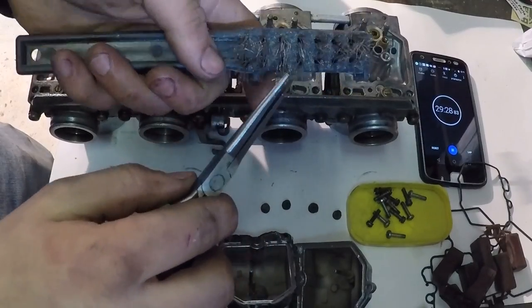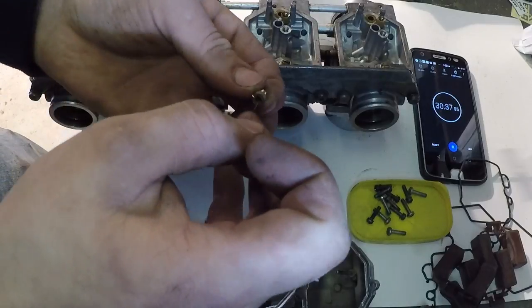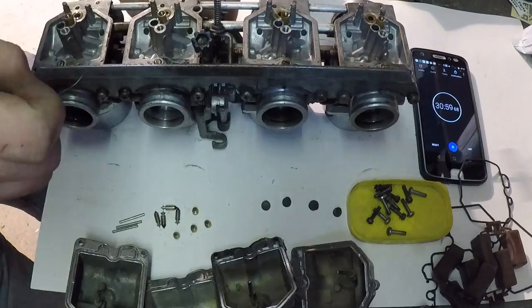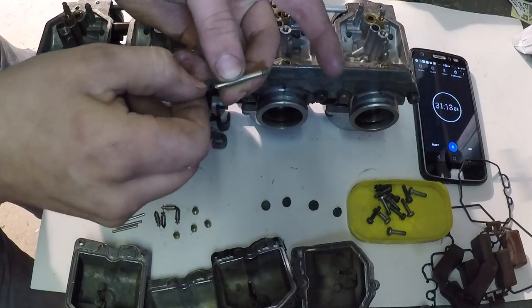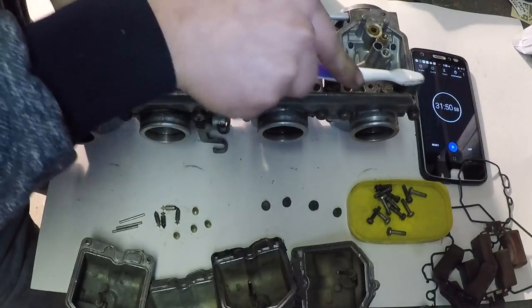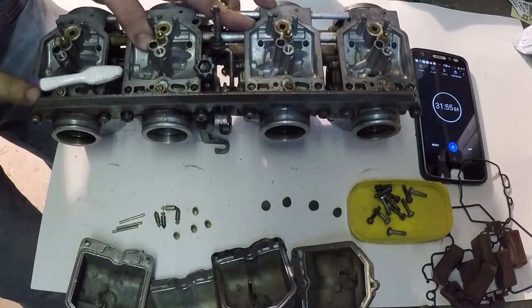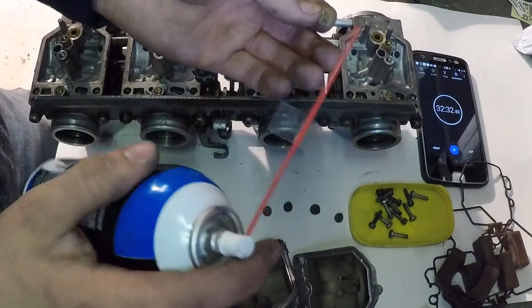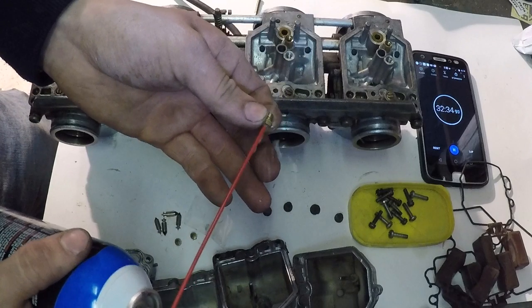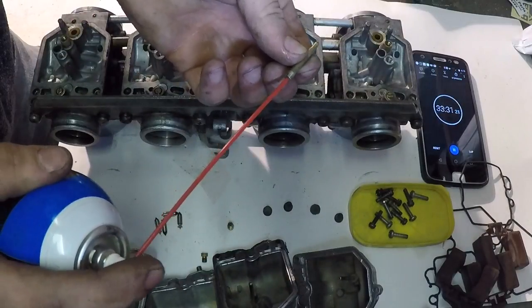Probably the most important part of this whole job: get a steel wire brush and pull one of the wires out, then run that wire through each jet to make sure there's nothing left — no dirt, nothing. Clean out all the pilot jets and main jets. You can also use a toothbrush to clean your bowls and carburetors if they're still really dirty. Once you've broken up whatever was in the jets with the wire brush, spray them all out with carburetor cleaner until they're squeaky clean.